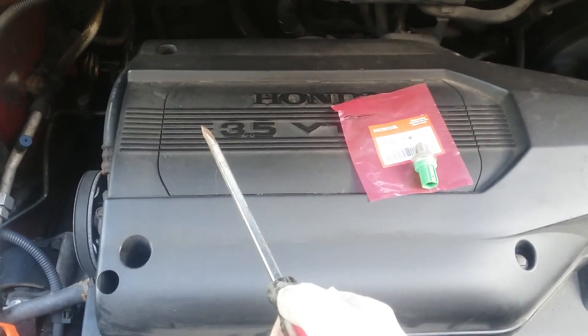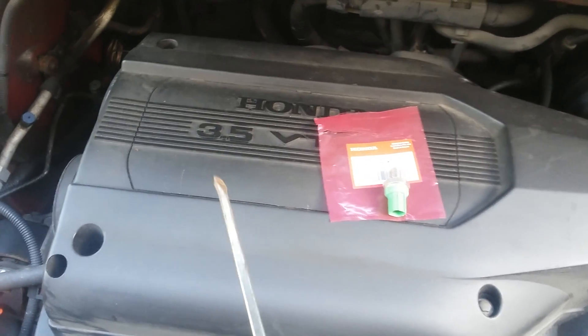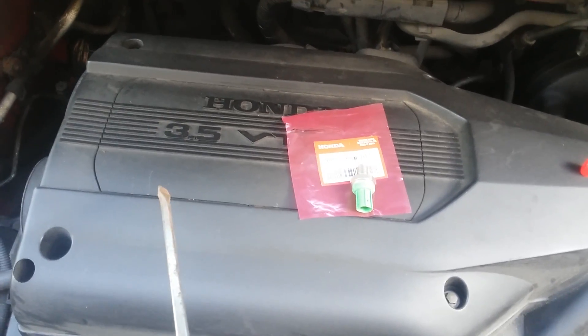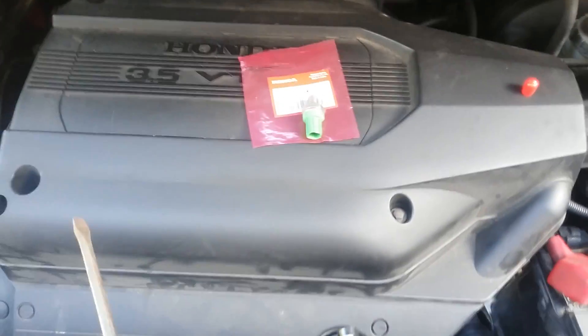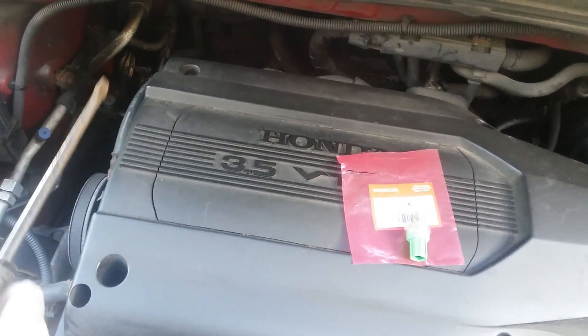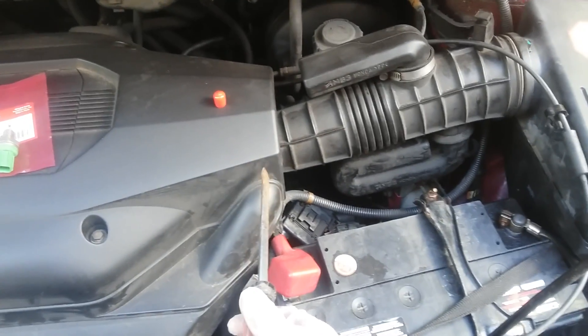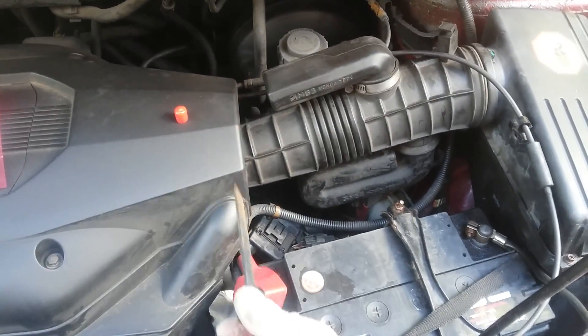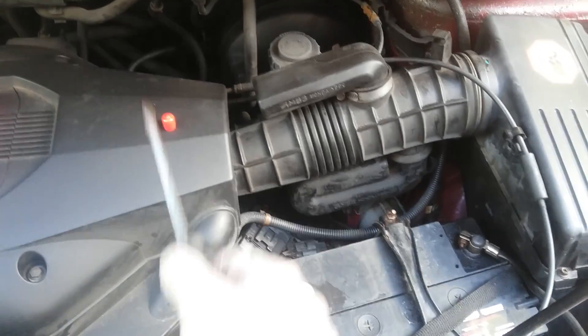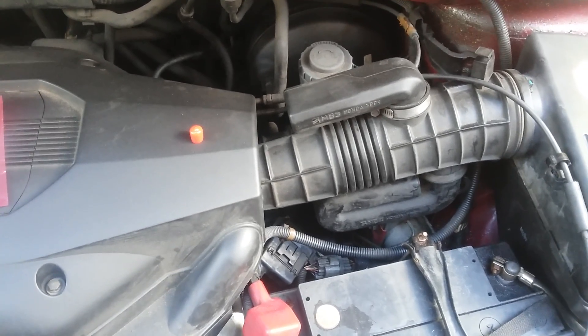So it should be located somewhere here under the intake manifold. You have to take the top plenum off to access the sensor. Now if it's a four cylinder and number one is on this side, you will still find the sensor on this side. If the engine starts on the other side, that means your transmission is on the other side and number one cylinder is on this side — then the sensor will be on this side once you take the plenum out. It's always under the intake manifold.